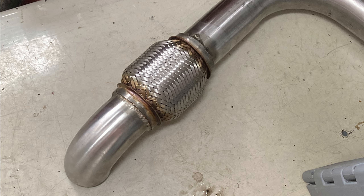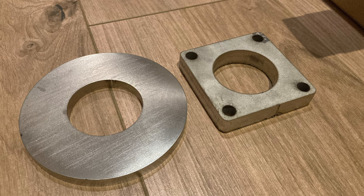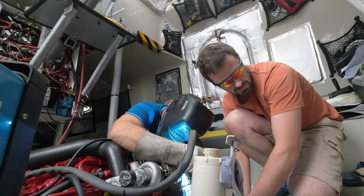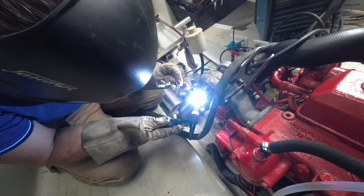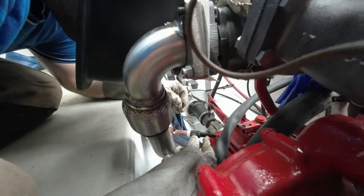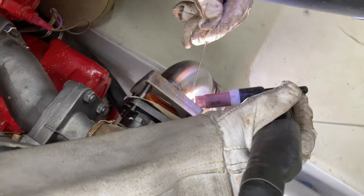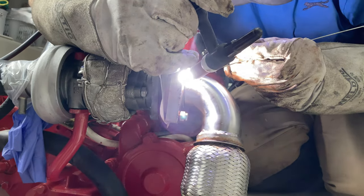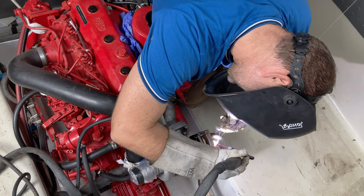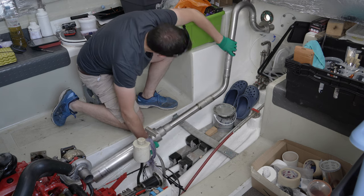We weren't done yet though. The final flange to meet the turbocharger had to be welded on board. The angles were demanding, so along with the other laser-cut flange, we carted the welding machine and its owner aboard Allen. I was rather more useful this time round, deployed to simultaneously hold the flange millimetre perfect, jam a finger behind the silencers so enough space remains for the lagging, and then looking away, as apparently my budget sun specs are no match for the onslaught of the brilliance at the hot, sparky end of the operation. Our dream team became one of total trust, given the proximity of my fingers to said sparky things. Once tacked into place, Dean did a double reinforcement of the weld to ensure it was rock solid. But it wasn't time to bolt everything together just yet — it all had to come back out of the boat for more work in the sunny autumn weather.